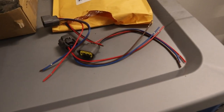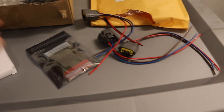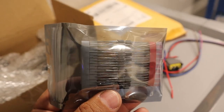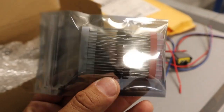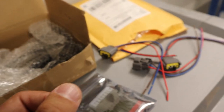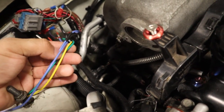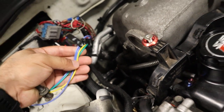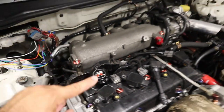And here are the diodes that I needed to add. I just got to solder them in and that's it — just four of them. These four wires right over here. I just got to cut them, put a diode in between, and heat shrink it. And that will protect the coil packs.